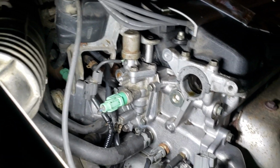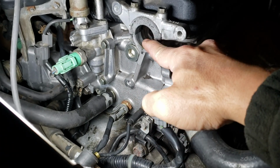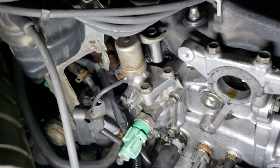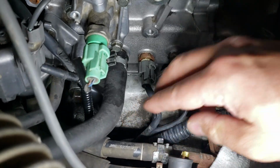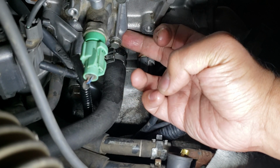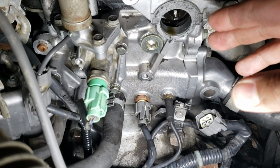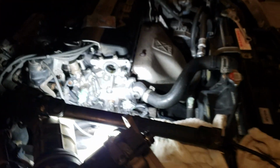So there, I'm gonna explain way better now. From here drips the oil, because all the oil inside starts splashing, and it's gonna drip down here to here, and some of this stuff is wet because of the movement of the engine and the force of the air that's splashing it towards the back of the engine, and this settles down to the transmission bell housing and all the way to the back end. To me, I thought it's dripping from the solenoid here, but there's a little bit of a wet spot here because the distributor is up on the front and the wind blows this way, so that's why the oil is collecting to the back of the engine.